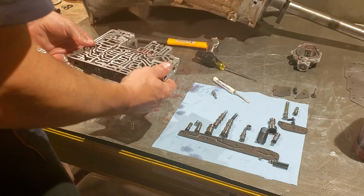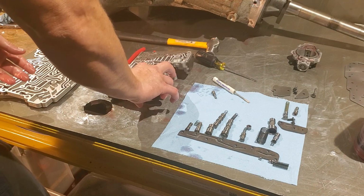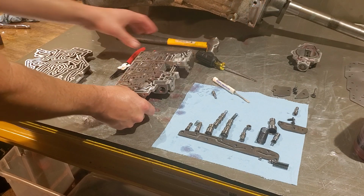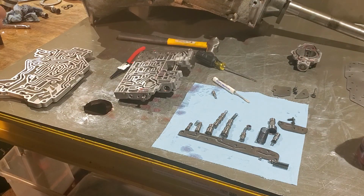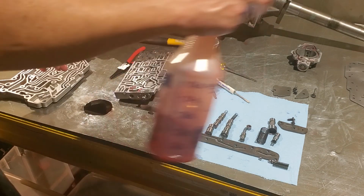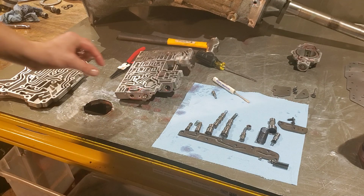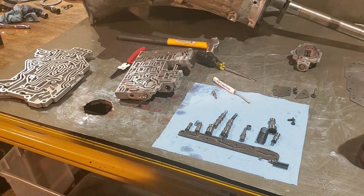Much better. Okay. Now, let's go ahead and move on to this side. We're going to do our throttle boost valve. That's going to go right inside there. Give her a quick squirt, and then our low schedule valve will go right there. Give her a quick squirt, and then that updated spring that goes in the low schedule valve essentially just blocks the valve off. You can really use anything, but you need to have the spacing perfect so the valve doesn't slam up against it and break. Essentially all you're doing is blocking that off.